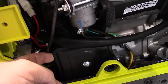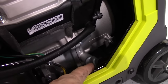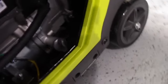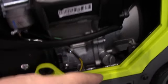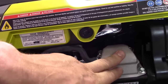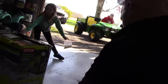Looking inside: this is probably the air filter right there, this is the exhaust, and here is the oil port — the oil hole — we're going to fill it. They do give you a tray so you don't leak oil inside the housing. Your spark plug is right here, this is your carburetor, this is your valve cover, single cylinder, and there's a storage fuel drain screw — open it up and it drains out all the water and fuel. We're going to go ahead and put some oil in it.